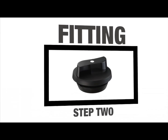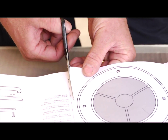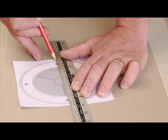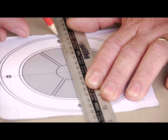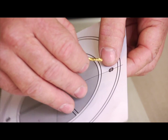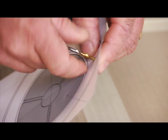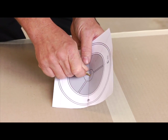Fitting step 2. Remove the fitting template from the instruction leaflet provided with your ventilator using scissors. Once you have your cut-out template, draw a pencil line from one of the screw holes to the opposite screw hole. Repeat the process for the two remaining screw holes — this allows you to mark out the exact centre hole you will need to cut in the vehicle roof. Using a drill bit or other pointed object, carefully puncture the template in each of the four screw hole positions, not forgetting to also puncture the centre mark.